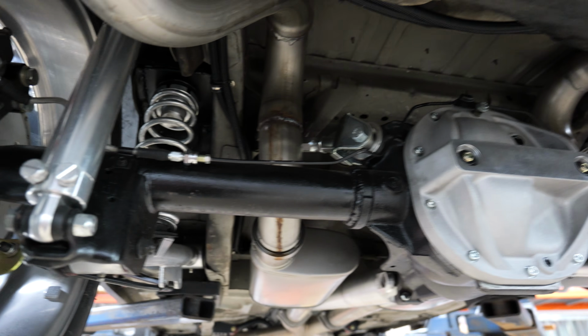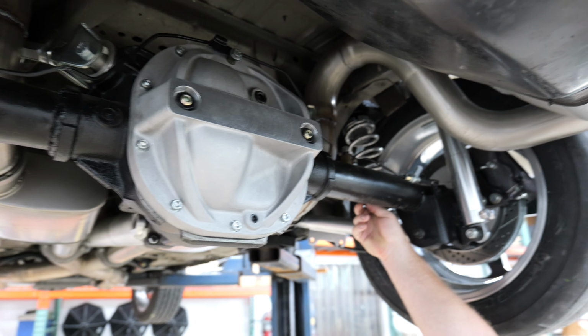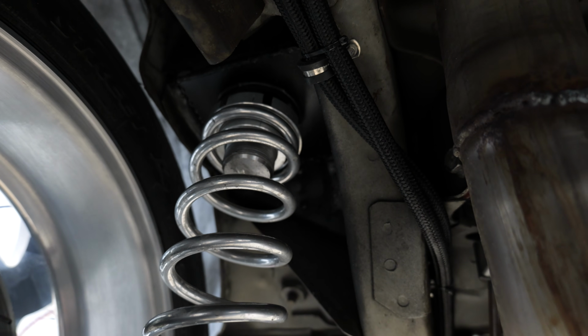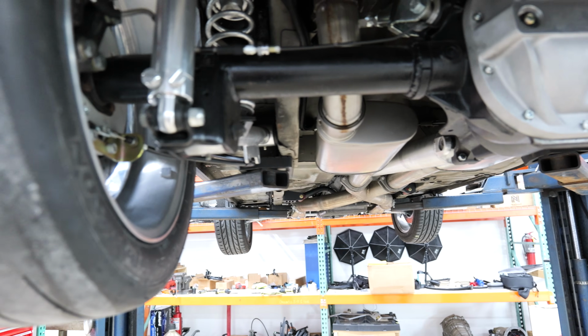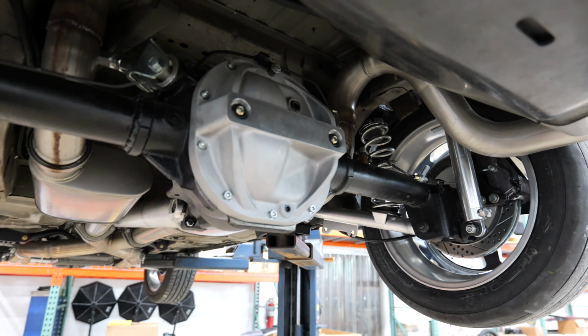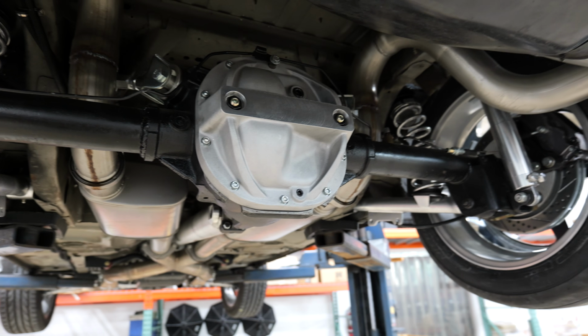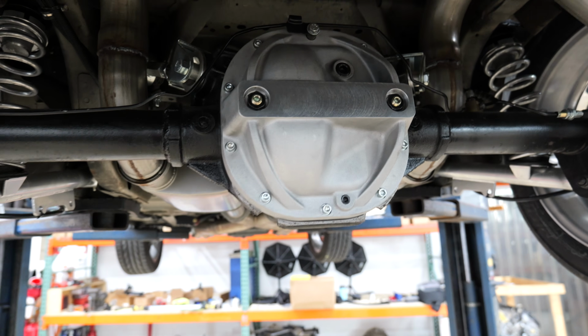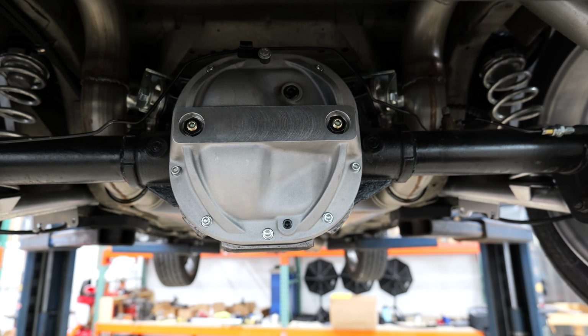And in this case, we're using the UPR's 2007-100 part number spring kit. So it's a weld-in spring pocket that's adjustable. In this case, we're using a 10-inch, 200-pound spring on this car. This is a full body, full weight car. As you saw, batteries in the front, but we have the full-size fuel tank in here.